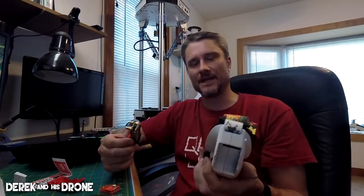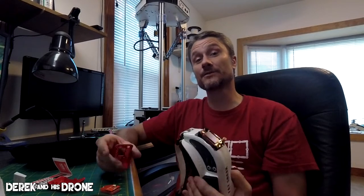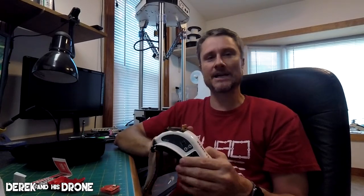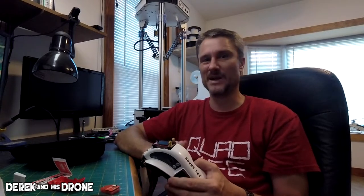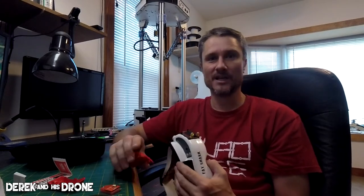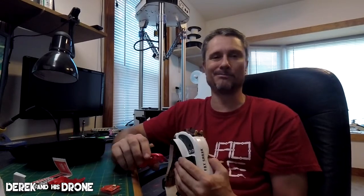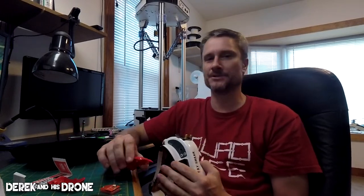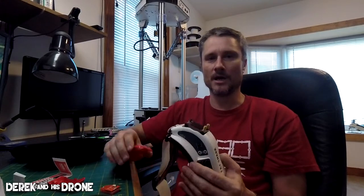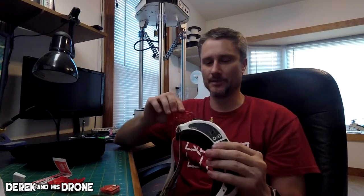Well, there's actually a modification you can do to the Fat Sharks. It's called the L1 inductor mod, if that's something you're looking for. If you're feeling brave enough to physically remove pieces from your goggles, there is actually a component that if you remove from the board, it's there really as part of best engineering practices, but it can be removed. Just search for Fat Shark Rapid Fire Hack or Rapid Fire Internal Modification or Power Modification or something like that. You should see what I'm talking about. But you do have to hit your Fat Sharks, the board, with a soldering iron. That might turn some people off.